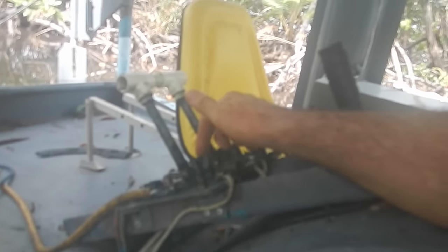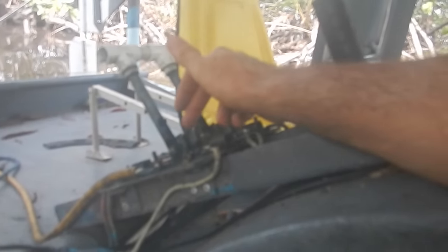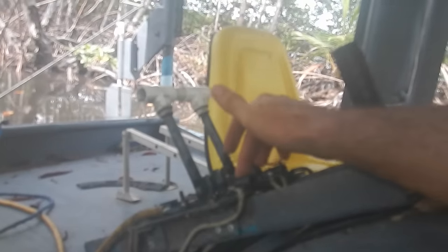The first connector here connects solar panels directly to the motor. The second connector, I want to connect the batteries to the motor but through a resistive piece of wire, like a coil of wire. This will be reversed for reverse, so reverse will be only two-thirds speed. I pretty much always drive this boat at full speed, so basically I just need this lower speed as a soft start for the motor - not jamming it right into full power, shorting the batteries right to the motor suddenly causing sparks. And that function is actually taken up by the solar panels right now since there's enough sun to start the motor up.